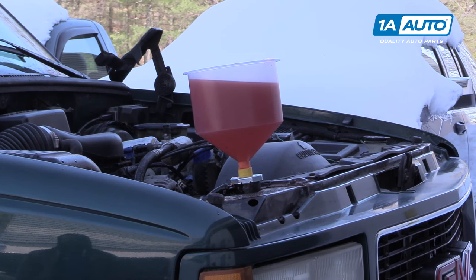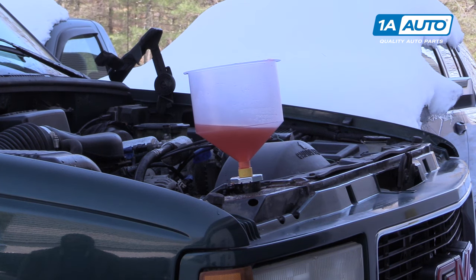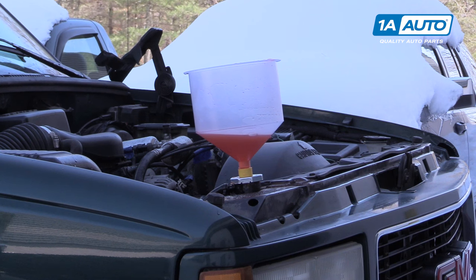Just run the vehicle. Keep an eye on the temperature gauge. Let it get up to temp and monitor the coolant level inside of your radiator and top off as necessary. You'll notice that there will be several surges where it sort of burps and an air bubble comes out. It loses some fluid, you top it off, and this process will probably repeat a few times.